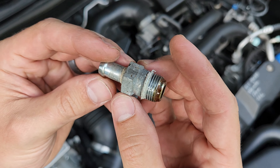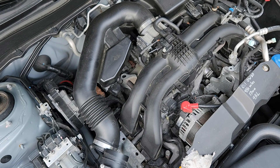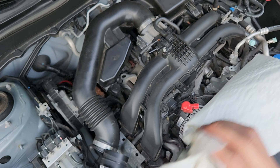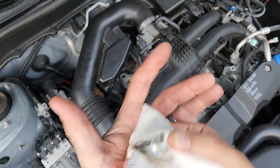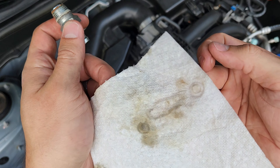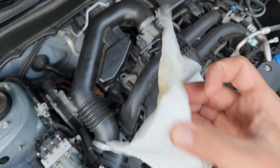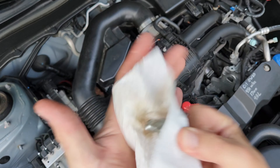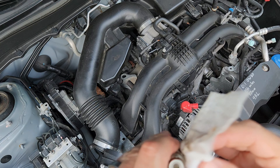I'm just going to go ahead and clean this up and put it right back into place. I had some carb cleaner, sprayed it in there, and covered both sides, just keeping it rocking back and forth. It now moves quite a bit freer — you can hear it a lot easier. I covered both ends, rocked it back and forth, and you can see there's a little bit of buildup in there. I know this one works — there's no point in replacing something that works.